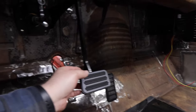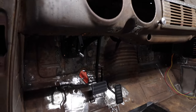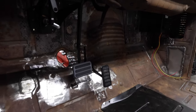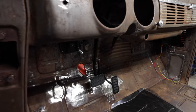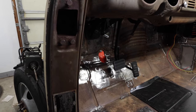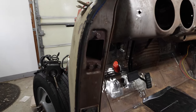The pedal swings down and I'm mounting up all the rest of the linkage there to connect to the hydro boost brakes that it's going to have. I also got one of these universal floor-mount gas pedals, which matches the brake pedal and is going to complete the look. It makes it really clean, eliminates the holes in the floor, and makes it easy to update the braking.